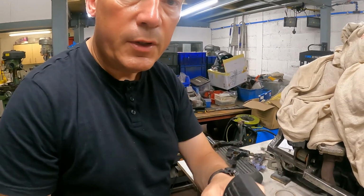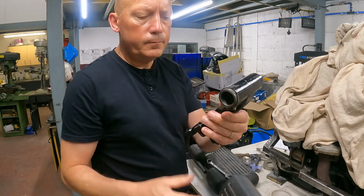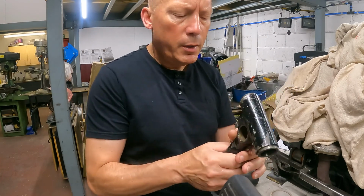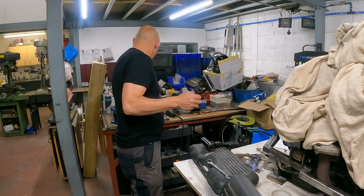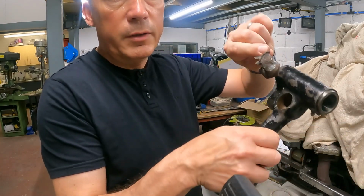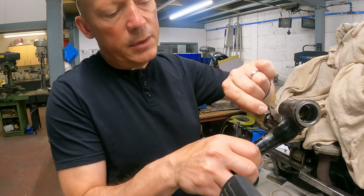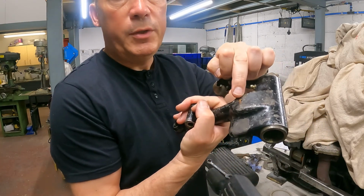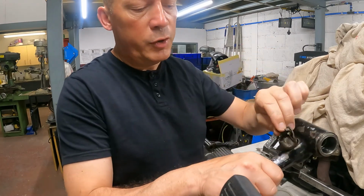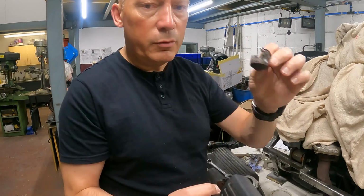Right, let's see what we can see. So yeah, eBay item again. I was missing the shock absorber bolt there I mentioned, which I should have ordered. Horrible job. You get these nylon caps which the suspension cone sits in, and they kind of glue themselves into the top arm there. I sprayed some WD-40 in that hole, cleared the hole out, sprayed some WD-40 in there to help try and shift this, gripped it with some mole grips, tried to crowbar it out, bashed it, smashed it, and eventually ripped them out.